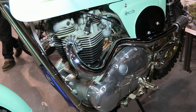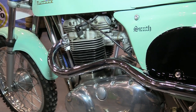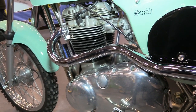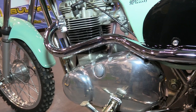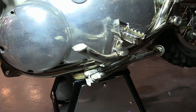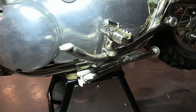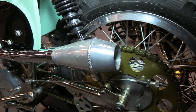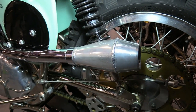Now, some of the specs of this Triumph motor include that it's fitted with full race Thunder conrods. It's got a high delivery oil pump, full race profile cams, Morgo tappets and blocks, Mark III Morgo 750 barrels, a single carb cylinder head, and a BSA scrambles gearbox, and a full NEB clutch, plus all of the chassis and its accessories have all been nickel plated. So what's not to like about this lovely machine?